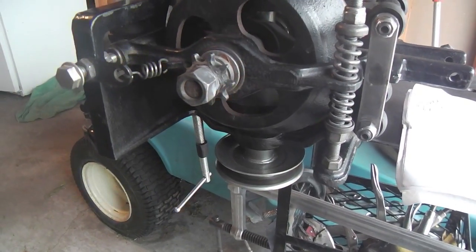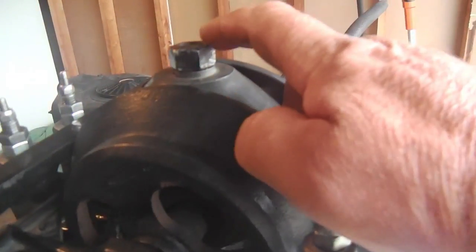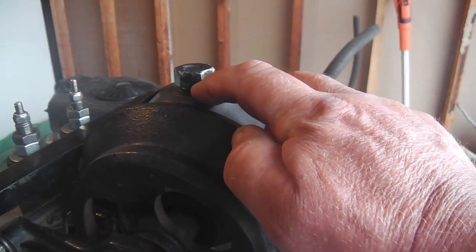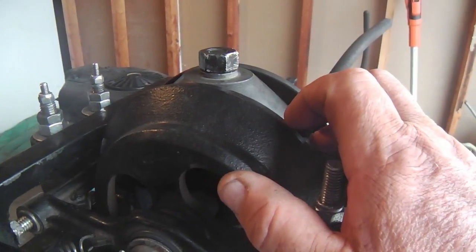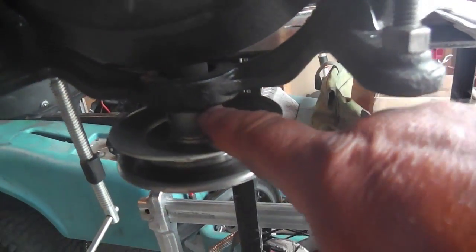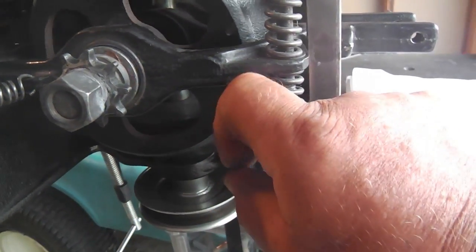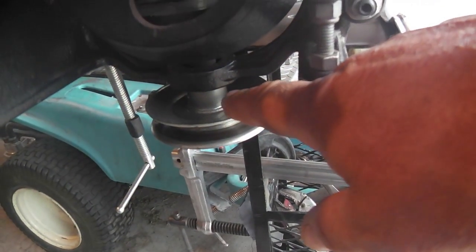And it's easy to overcome that, I believe, by just making sure you've got the nut riding down on that threaded part. I tack it up top here, and so that's a good thing. But also, you can take out that spacer there, and chamfer, bevel that edge of the pulley so it doesn't impinge upon the bearing, and that'll get you another thread or two.